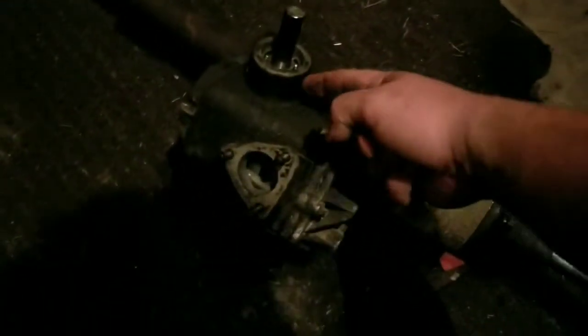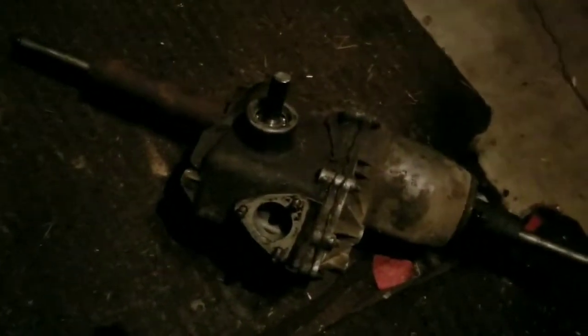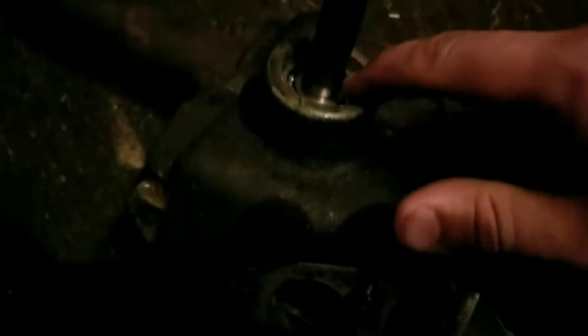Steel on steel contact at around 4,000 RPM is not going to last very long. That rat rod tractor is geared fairly high to be fast, so that shaft is spinning very, very fast. Even though I had the oil level filled all the way up, it still froze up. It's all back together now — I had a spare 600 and I upgraded it: pressed the bushing out of the bottom, installed a needle bearing, and put a second ball bearing on top in place of the seal. So now the other one is extremely durable — in theory. I've been running it for a while and it seems okay. But this one I kind of want to tear apart and see how bad the shaft is. If it's okay and I can just unstick it and remove the bushing, maybe I can save this transaxle.